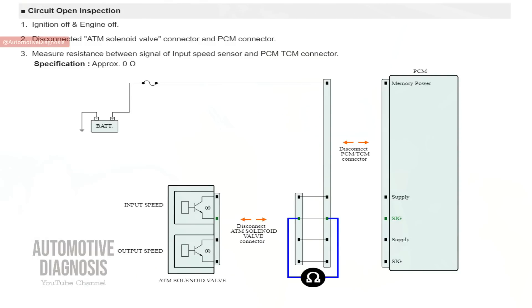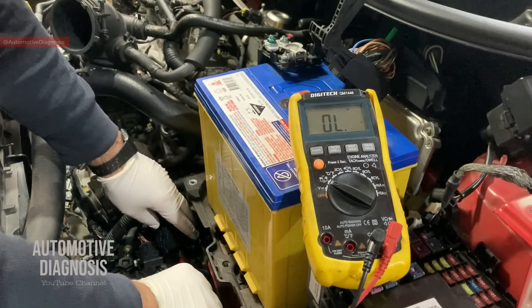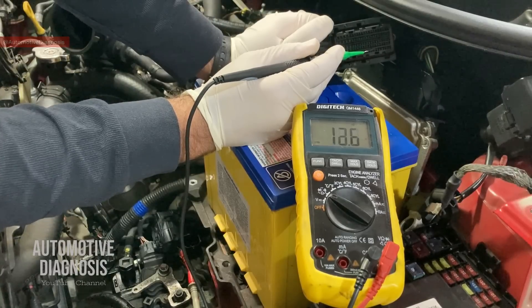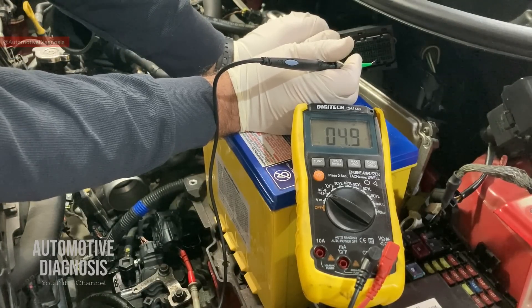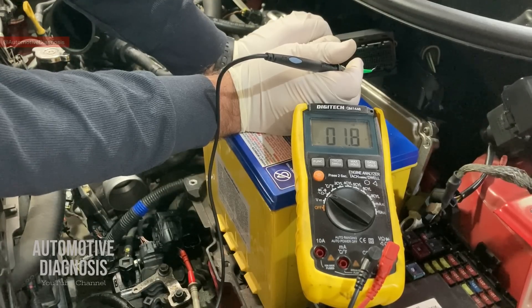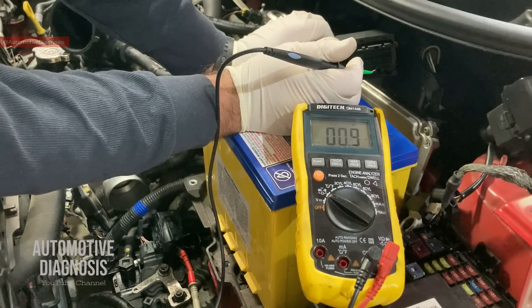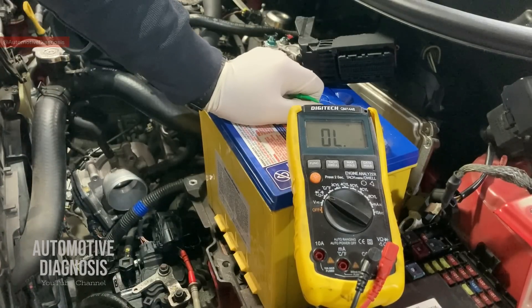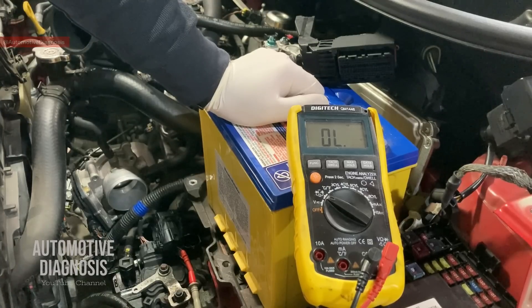Now I'm going to check the resistance with the multimeter. Select resistance — one end of the multimeter down here on the transmission connector, and I need to reach pin number 99 on the PCM connector. We are getting continuity, which means the wiring is not open. The resistance value should be something close to one ohm — even less than one ohm means the wiring is okay and there is no high resistance. This continuity sound confirms the wiring is not open. If you find a problem here, that's the cause of your fault and you need to get it fixed. Otherwise, most likely you need to go into the transmission itself to drain the ATF and reach the valve body.